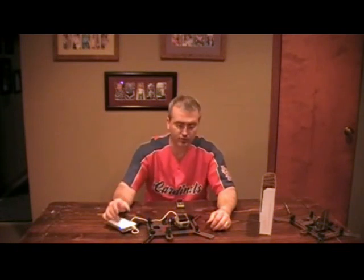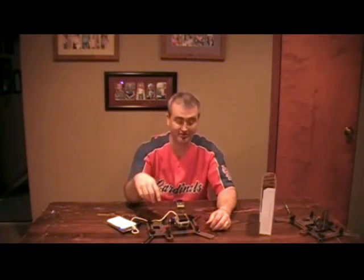The other thing I shoot with is the 64 gigabyte SanDisk Extreme Plus, I believe is what it is. You want to make sure you've got the recommended SD card. It's on GoPro's website. If you don't use the recommended SD card, you'll find that your camera will shut down. And I know that sounds bizarre, that an SD card could cause the camera to shut down, but it does happen, and it specifically happens when you're using Wi-Fi.